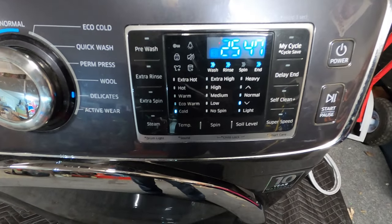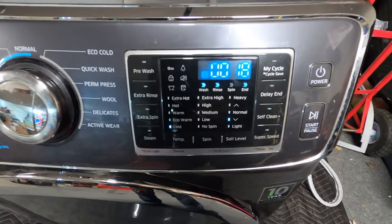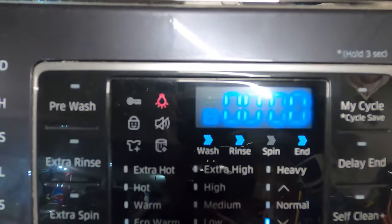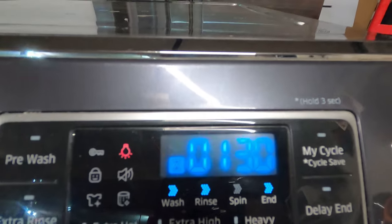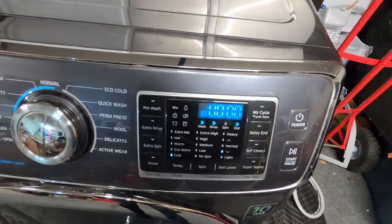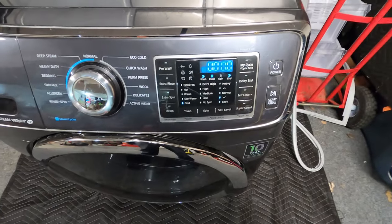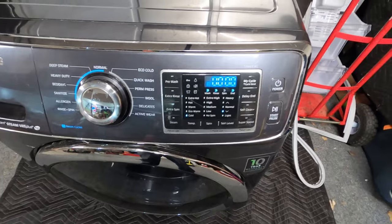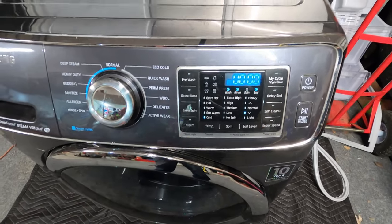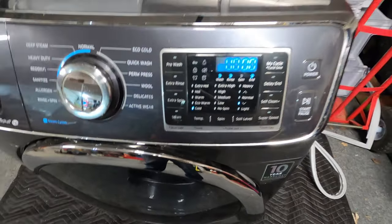There's another thing you can do — jog the dial all the way to number 18. You'll see zeros on the display. I'll come down here and spin the tub manually with my hand, and you can see the numbers changing. That's measuring the RPMs the machine is producing. You can run this while the machine is doing a cycle — it's like peeking behind the curtain, like the Wizard of Oz. You're just looking at what it's doing without touching anything or hurting anything. That's a quick test mode to check your water frequency and spin speed on these Samsungs.